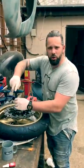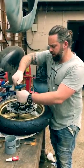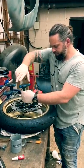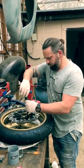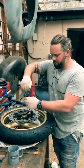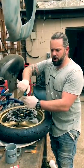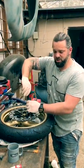Right, yeah, like I say, you do have to torque these down. Just gonna run them in with a normal Allen key. And the torque setting on these is really mild. They have got the Loctite on them, so they shouldn't go anywhere. It's about 20 foot-pound. I'll just do them slightly more than that, just to be sure.